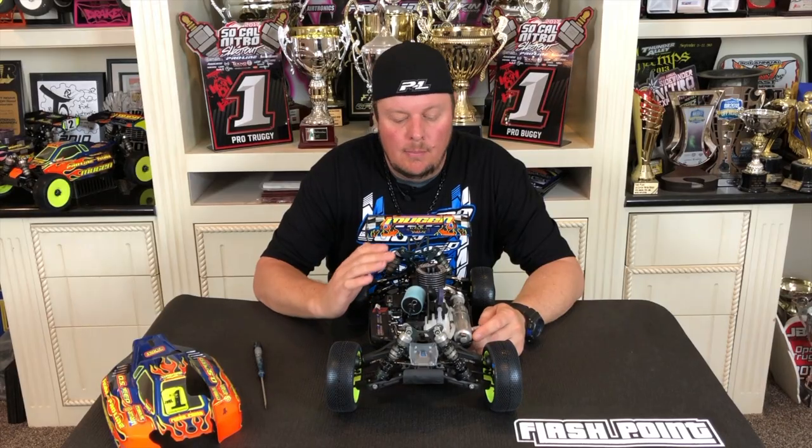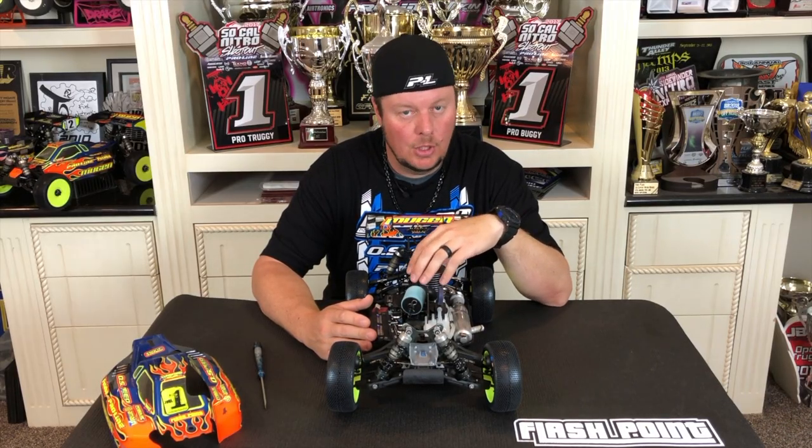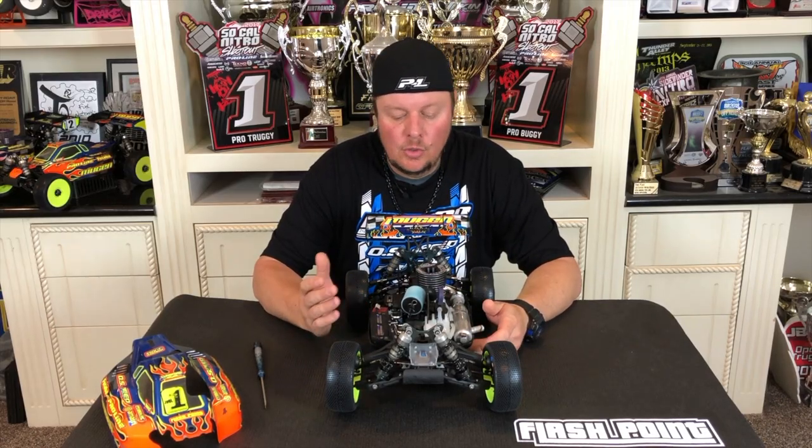The next tip before making any adjustments: make sure that the engine is fully saturated with heat. Basically you'll want to make sure that the engine is between 180 to 220 degrees before making any adjustments. Also when you start your engine you'll want it to slowly come up to temperature. I suggest using a Pro-Tech 12-volt head heater, heat gun, or blow dryer to heat the engine, and then when you first fire it up just use slow revs, bringing the engine up to temp.